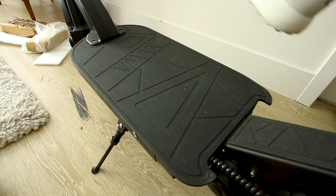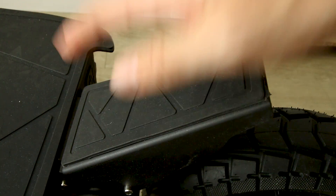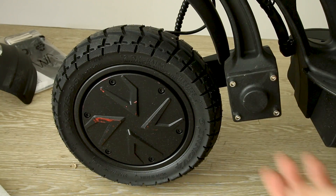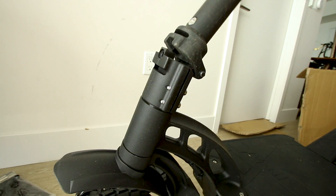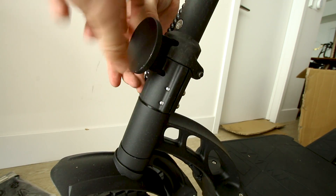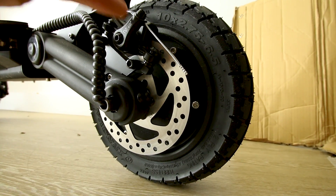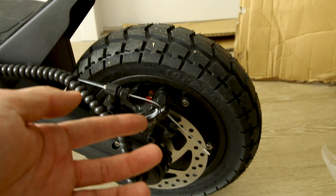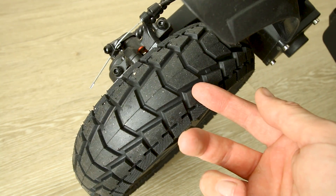It's got a pretty wide rubber deck — here's what a size 14 shoe looks like on it. Nice little rubber thing on the back for your back foot too. It's got 10-inch wheels. Looks like some sort of hubcap deal. Of course it folds in half, and here's the piece that locks it in place. Seems fairly sturdy. Of course it is dual-motor and it has mechanical disc brakes, which is probably fine because there is regen brake on this. The tread on the tires is obviously meant for the street.